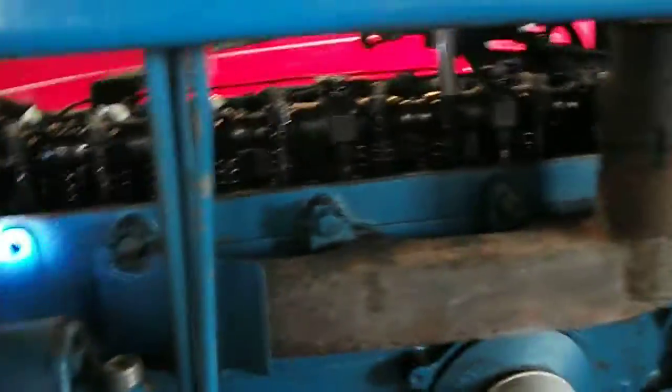Now I'm going to go over to the other side and show you that I have it at top dead center. As you can see in there the number should be zero — the pointer will read zero, which means you're at top dead center on either number one or number four.